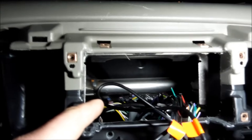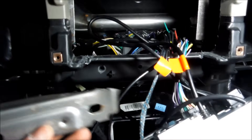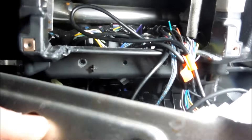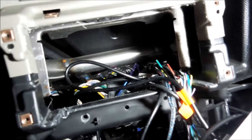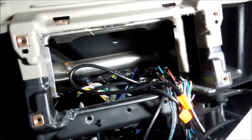Hey guys, how's it going? We're just about to put the stereo in. These holes aren't big enough, so the best way to say it is you're going to have to cut a bottom piece off of this metal that will be behind down here. What you're going to have to do is loosen the two 8 mils right there, and then you're going to have to cut through there. You can either use a Dremel cutting blade, hacksaw, grinder, whatever you can fit in there. And then after you trim those, if you can, just bend these tabs in a little bit, and then cut right here. You're going to need a squeeze point to squeeze this radio in, and you're going to have to put quite a bit of pressure on it. It's pretty tight — you can always shave this with a file. Once you get it there, squeeze it in, make sure all your connections are in, and test it before you put it on. Biggest thing ever.